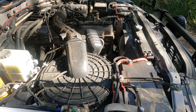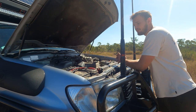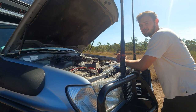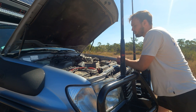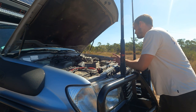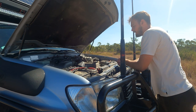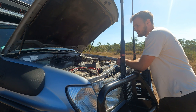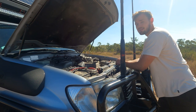She's a 1FZ-FE engine — a FZJ 105R 2002 petrol Land Cruiser. We haven't done too much special under the bonnet. We've done a 120Ah AGM deep cycle battery and a Redarc Smart Start Isolator, which is pretty much a must-have with any touring vehicle. We've also done new extractors, all new pipes, a new radiator, new thermostats, new alternators, and pretty much everything else — power steering pumps, etc. Just before our big trip we went over all of it to make sure she's rock solid. Fantastic engine — she just likes to drink fuel, but all these old cars kind of do.